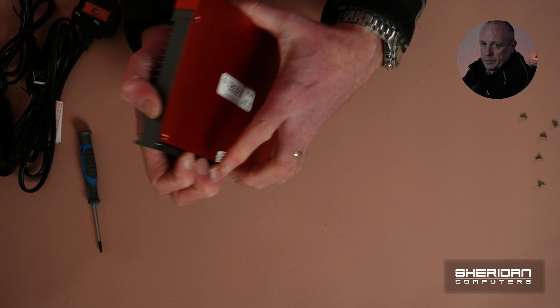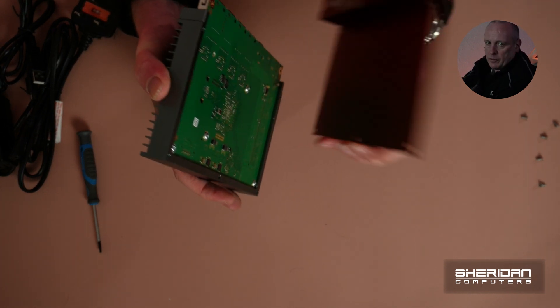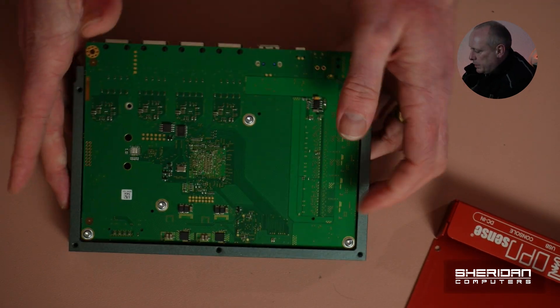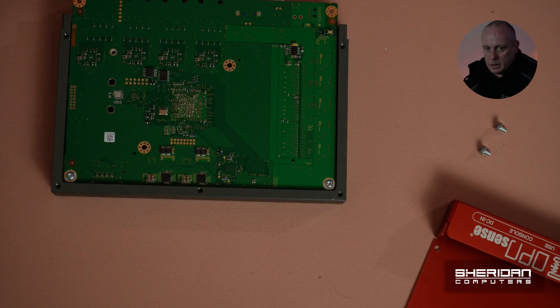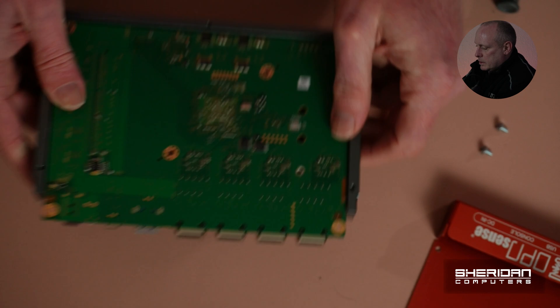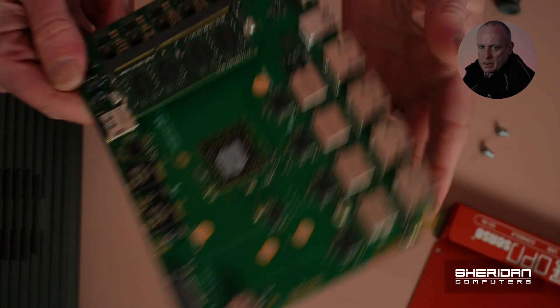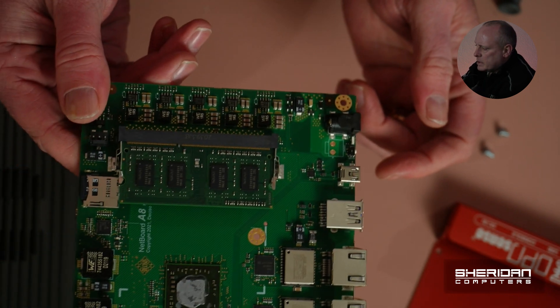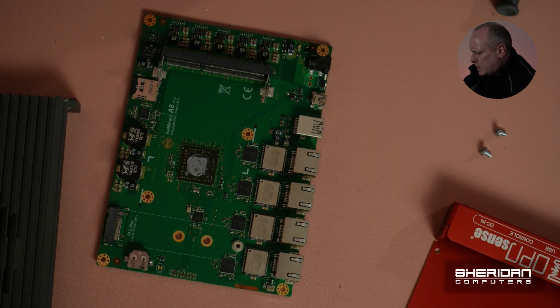To remove the casing, just gently lift the rear and then pull it forward, which exposes the board. There's not much on the underneath. The screws on the other side are slightly larger. This does look like the actual heatsink, so we are going to dislodge it. We can see the memory, which is a standard SODIMM — so I'm guessing that's upgradable. It's made by Transcend: 4GB DDR3 1600 SODIMM, 1R8, 1.5V.